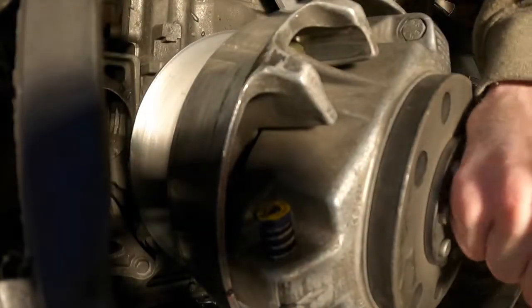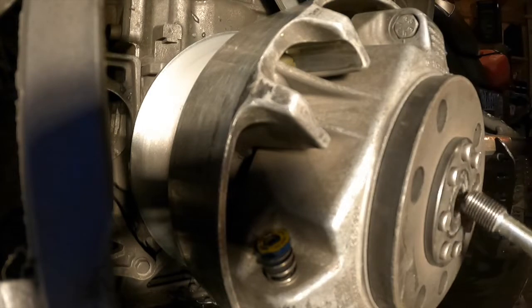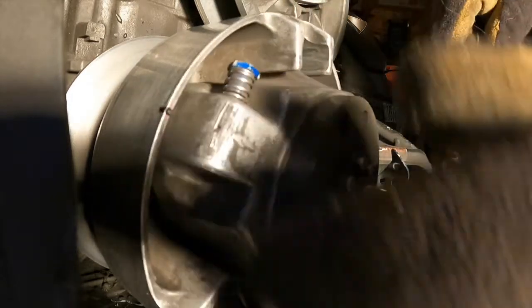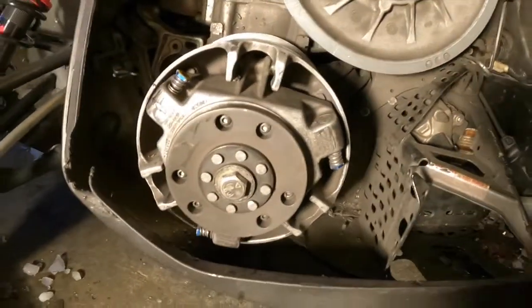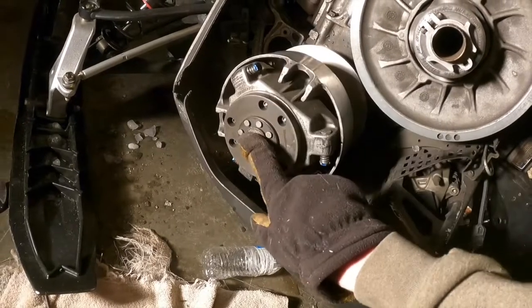With a little grease on the bushing and Never-Seez on the flat part, just take the clutch and slip it right back on, pushing it in as far as it can go. Then take your main bolt — make sure you still have the washer that was on there when you took it off — put that back on and get it started. You're going to need a torque wrench; tighten this down to 85 to 92 foot-pounds. That spec is actually on a sticker right on your belt cover.